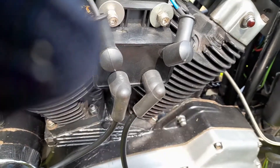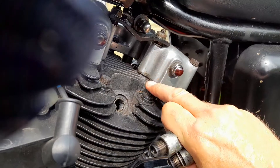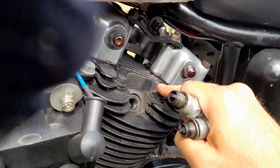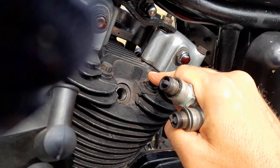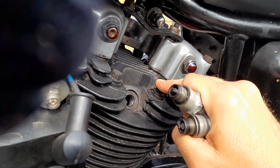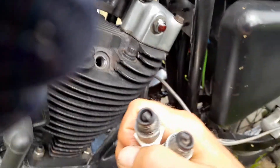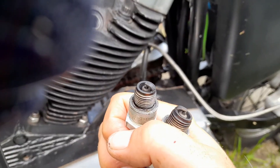Now what's causing this is one of the valve guides in the top of the head. It's slightly loose — it was very loose. I sent it off to be honed because the valves don't fit right away, you've got to send them. I don't know what happened but it's still a bit loose, and that's why oil is burning.